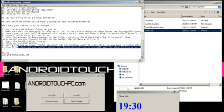And that's about it. Let this timer go down from 20 minutes to 0. At that point, your tablet will probably be frozen. It will seem that it's frozen and you cannot do anything. You're going to do a soft reset. Now, this doesn't have a pinhole or a button that you press. You simply hold the middle front face button for a good 10-15 seconds, and then it will turn off on its own, okay? And then you'll reboot the tablet. On the first reboot, sometimes the cache loading will cause the screen to hang or get stuck. Once again, hold the middle front facing button for 10-15 seconds, reboot it once again, and you should be fine. Okay? That's it for now.